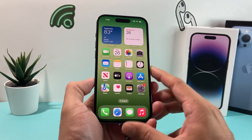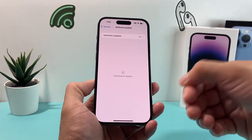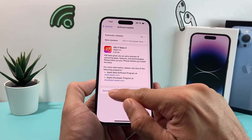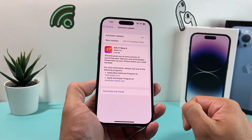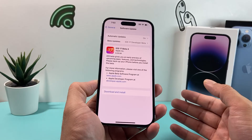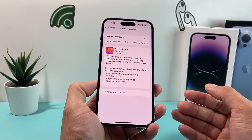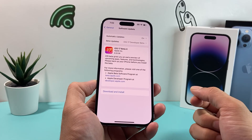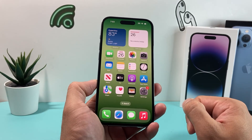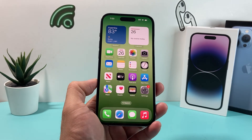After reinstalling and it's still not working, go to Settings, then General, then Software Update, and update your iPhone's software if an update is available. You'll see a Download and Install option — tap it. Make sure you're on a strong Wi-Fi connection with your phone at least 50% charged, and allow about 30 to 45 minutes for the download and installation to complete. Hopefully by now your Apple TV app is working. If this video was helpful, please like and subscribe — thanks for watching, see you next time.